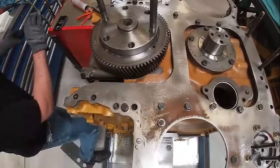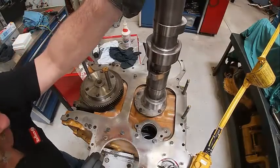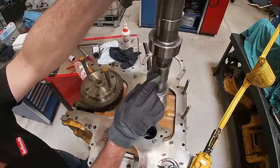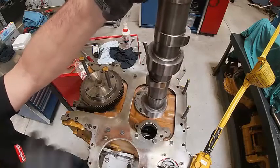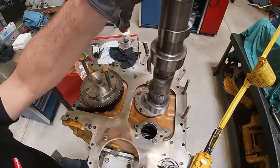We may have to move it once we put the cam in. I'm going to put my camshaft in. I inspected my bearings and they all look okay — I threw a little oil on them. I'm going to look at all the lobes. You can see this spot right here — that's bad. This camshaft is junk, so there's really no use measuring it. It's good enough for a teardown engine, but if you see any hard facing missing like that, it is junk.